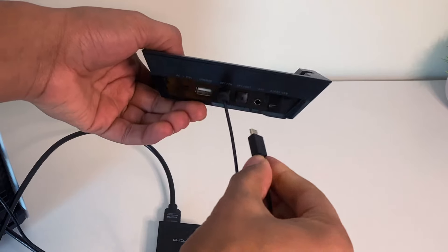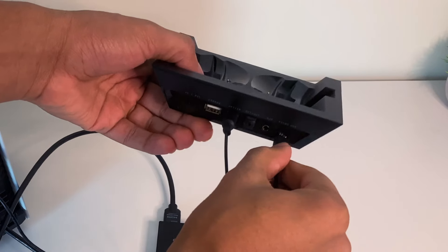With the base station, you'll know that the optical cable is plugged in once you hear a little click. Don't just leave it loose or else you won't get any audio — you need to make sure that it's in the optical in slot fully. And then lastly, make sure you're providing USB power to your mix amp or base station. The USB cable to power the adapter can be plugged into any USB port, but the base station has to be plugged in via USB to the PlayStation.